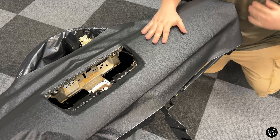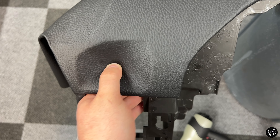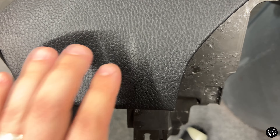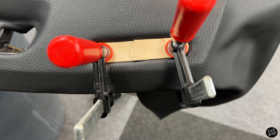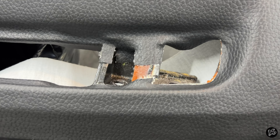It's the final stretch - no pun intended. Really late, I'm tired, I want to get this thing done. We got the hairdryer out to relieve some of the stress on the vinyl in these tighter areas. I heated it up, pressed in with my finger firmly until it cooled down, and it gave me just enough stretch and material to meet the landing lip about a quarter of an inch down. I'm going to cut an X, put the adhesive on there, and once it tacks up I'll stick it all together. Over here I took one of those small paint stir sticks, broke it in half, and placed it in the vent plate area. These little clamps are here till tomorrow.